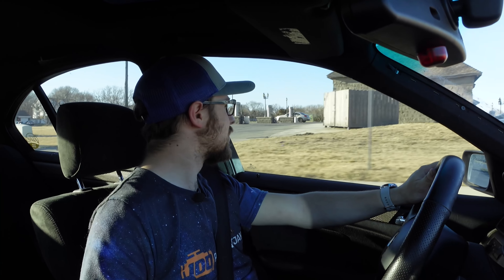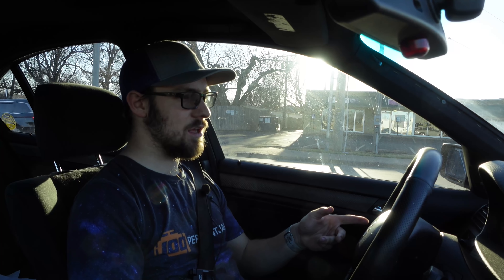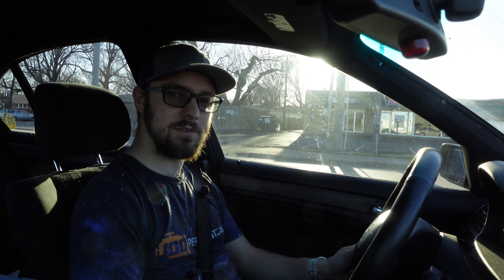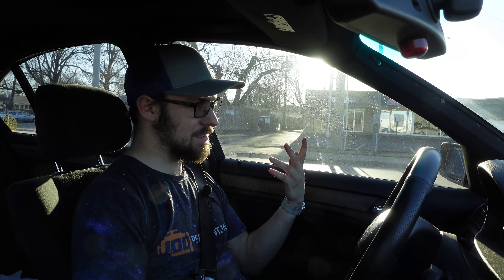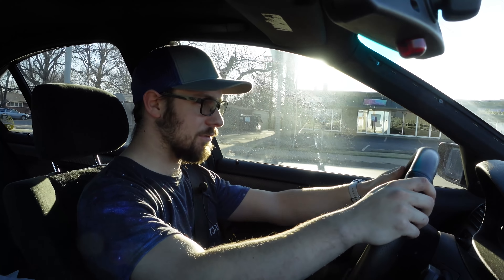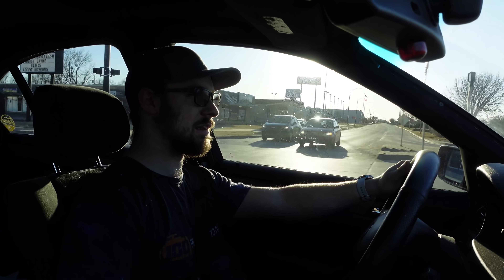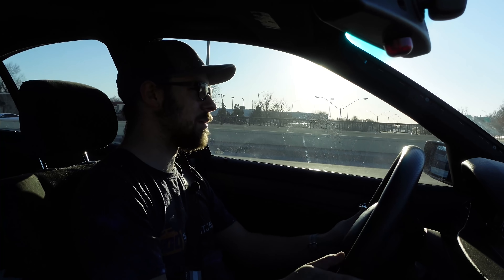My rev matching is easier again. My OBD2 reader has decided not to connect to the car anymore for some reason. Hopefully this is the last I see of that check engine light. I do have one other check engine light I get every now and then — that's for the barometric pressure sensor. On the MS45 DMEs, the pressure sensor is actually soldered inside the ECU itself, so fixing that means desoldering a surface mount component and soldering a new one on. My hands are not steady enough for that, so I'll have to take the DME to someone, which means the car will be down for a few days, and I can't afford that right now. The bigger issue I really wanted to take this thing off the road to fix is I'm pretty sure my subframe mounts are torn.